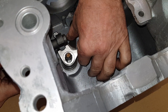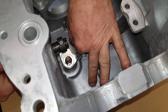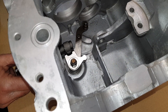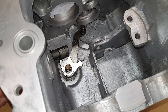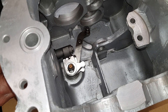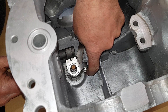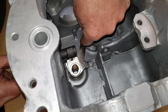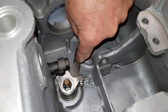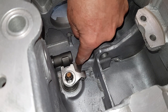As you turn this round you'll see how this all works. This actually drops down into there, and as you push across the gearbox gate you'll see this will go that way and that way. As you push and pull on the gear stick it literally pushes and pulls those backwards and forwards. This little piece under here is the piece that pushes the selector fork into whichever gear you're selecting. Come up and it moves the next one; go right down to the bottom and it moves the reverse gear one.